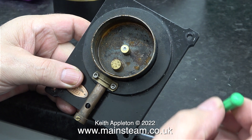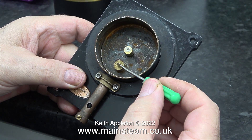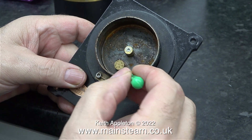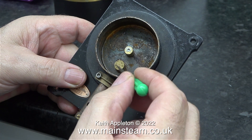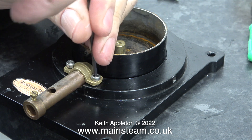In the centre of the burner is a threaded bush which holds the ceramic in place. But then there's also this bit, which is a diffuser to slow down the speed of the gas. The incoming jet of gas hits this diffuser and bounces around, making the burn more even.